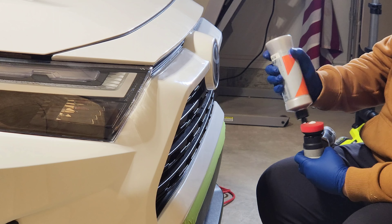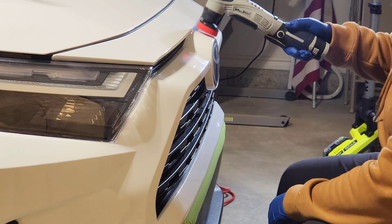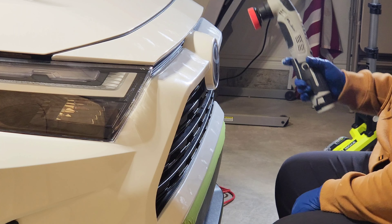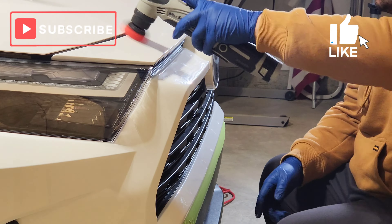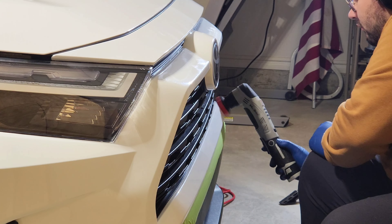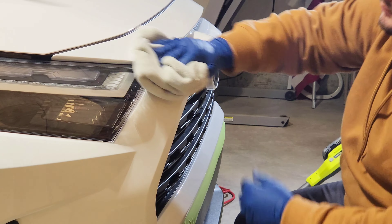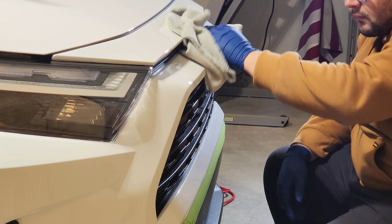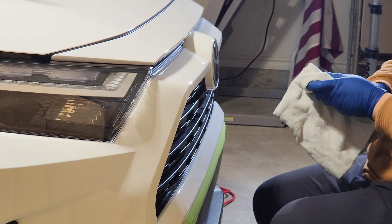We'll be throwing on some Car Pro Essence to finish up this two-stage on the bumper. I'm using the Max Shine red pad, which is their finishing pad — I will say these pads feel very cheap and tend to break down quite early. If you invest in one of these polishers, also consider investing in better pads. I ordered two-inch and one-inch pads from Lake Country's SDO line — the same foam system as my HDO pads, so it keeps everything consistent. Car Pro Essence also seems like it'll be great for restoration maintenance since it barely has any abrasives and contains a SiO2 sealant.